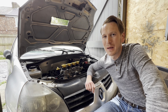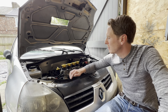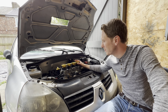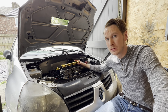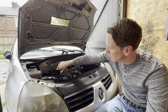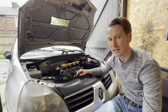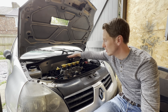These throttle bodies are from a Kawasaki ZX-6R motorbike — they cost about £45 to buy. I then 3D printed some adapters and attached them onto the standard engine's intake manifold runners. I cut the top half of the manifold off, 3D printed adapters and mounted these throttle bodies on top. Then we did some rewiring for the throttle position sensor, the mass air flow sensor, and the throttle cable. It runs absolutely fine and obviously it looks awesome.